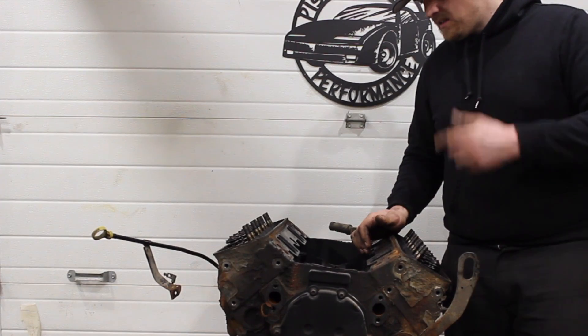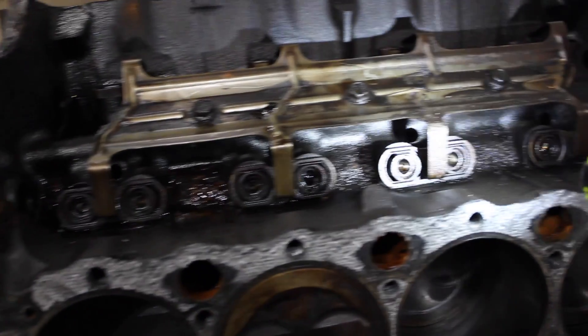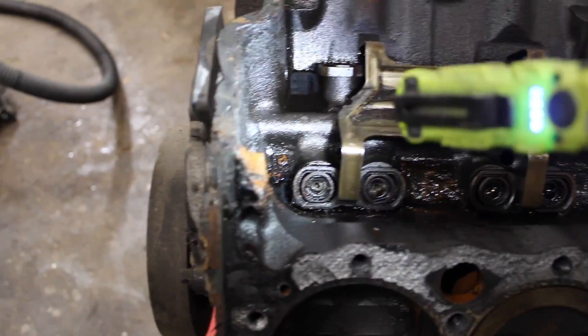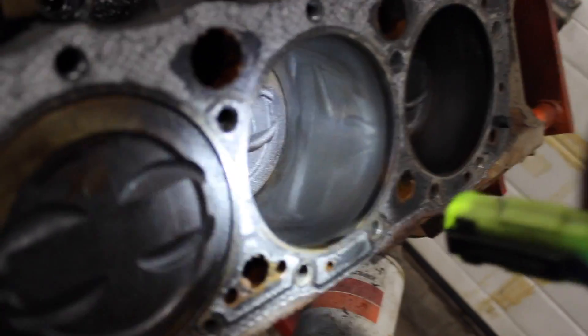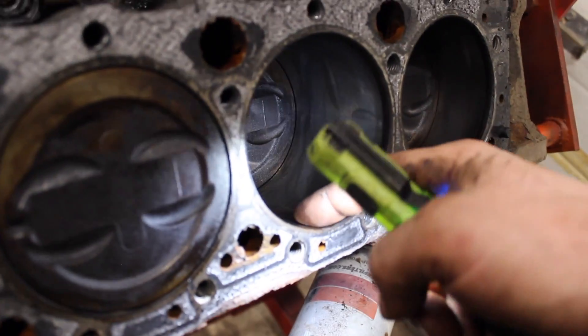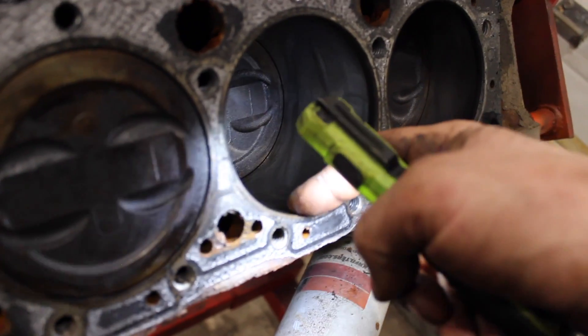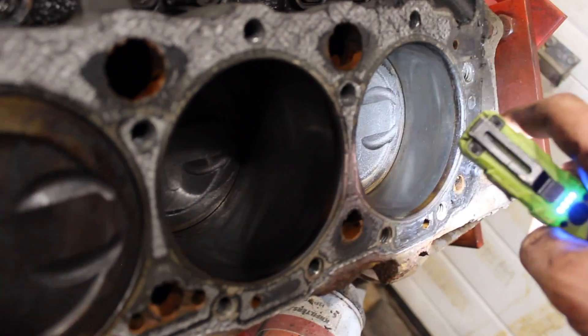I'm going to go ahead and rip the heads off and see what the cylinders look like. As you can see, you get the normal crustiness — typical, especially when you see a little bit of intake gasket failure, which we did on this. But look at the cylinder bores. That's the thing with these late model blocks, especially the Vortec blocks — there's not even any ring ridge. Even with high mileage, you can just slide the pistons right out, no problem. You can still see cross-hatching in the cylinders.